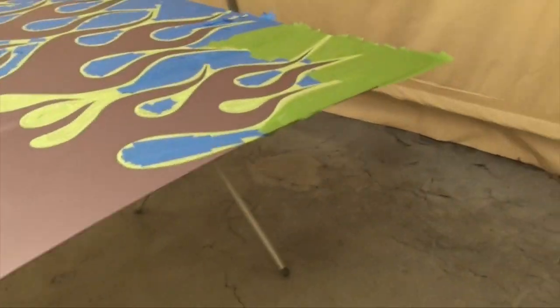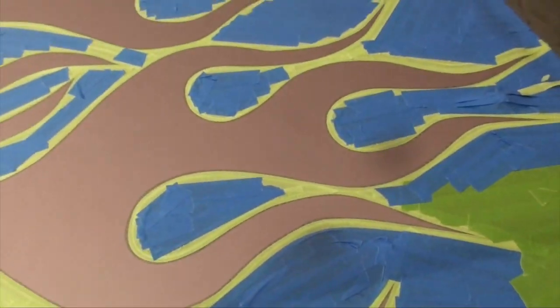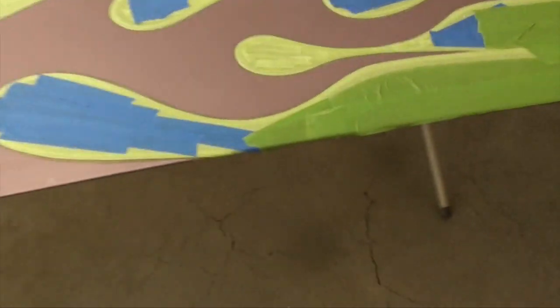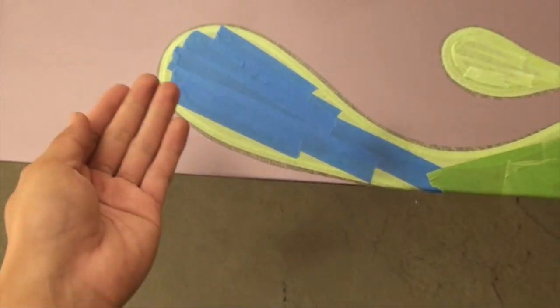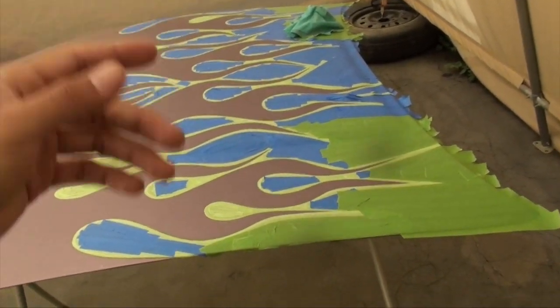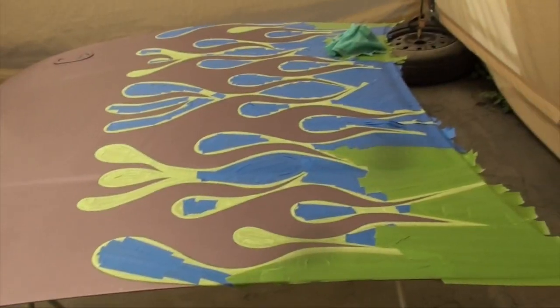We made it. I didn't document too much of the taping because it's pretty terrible. Instagram lived it, and I'm sure that was boring as hell. But gonna go ahead and spray it. The plan is to dust a couple coats of yellow on here. As you can see, I've masked it, not exactly on those hard lines, and I'm hoping that I can then tint this a little lighter, and then I'll pull the tape and do another 1 or 2 coats over the whole thing. So this will be the Kevlar getting tinted yellow, and this should hit full base color. See how it goes.